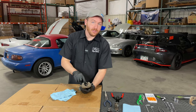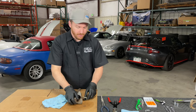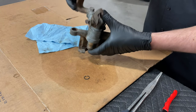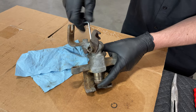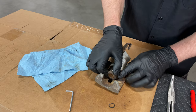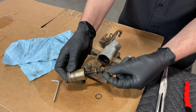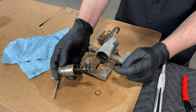Now that we have that snap ring out of there, we can take the threaded rod out of the caliper itself. You can grab onto it and wiggle it, or to be extra careful, take the old or new piston, set it against the threaded rod, make sure you have your little splined drive in the back of the caliper, and then use your Allen to thread the rod in just a little to catch a few threads. Then take the caliper and separate the piston, wiggling it back and forth, and out comes the threaded rod plus the spline. Also, there's a very greasy little dowel rod here — if you don't see it, it's still in the caliper and you'll need to fish it out.